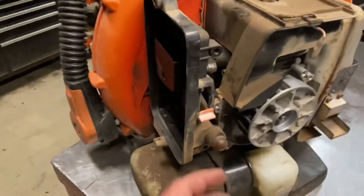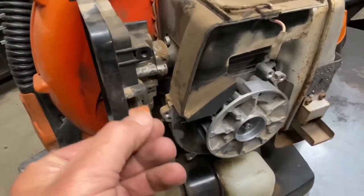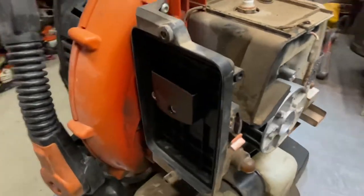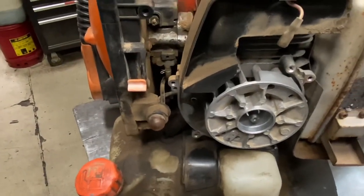The choke housing, like I said earlier, will occasionally loosen up over time just because of dirt, wear, and use — so make sure it's working properly and nice and stiff. The primers are super simple to change — just a simple snap-in Walbro design.